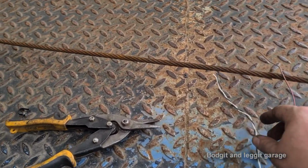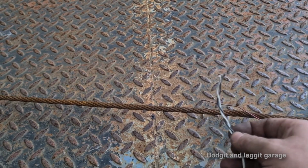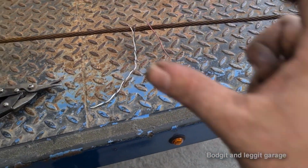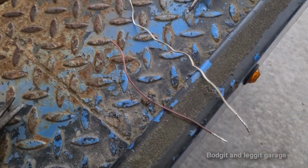Also, another good thing for keeping old wiring looms is the plugs on it. If you want to make pigtails for the plugs and stuff, like I've made loads for testing injectors and all sorts, you have all the plugs and the connections off the old wiring loom. Really handy. What I'm doing is I'm cutting all the wires and I'm tinning them.